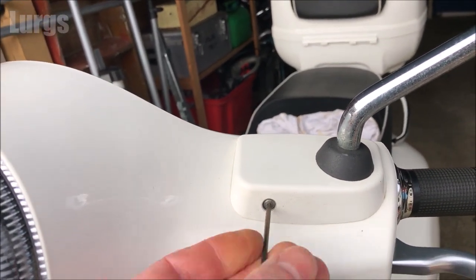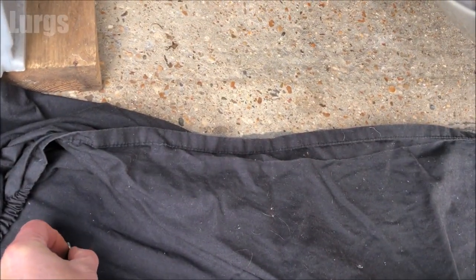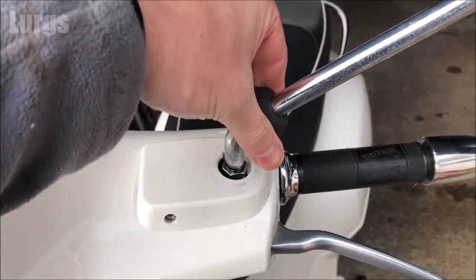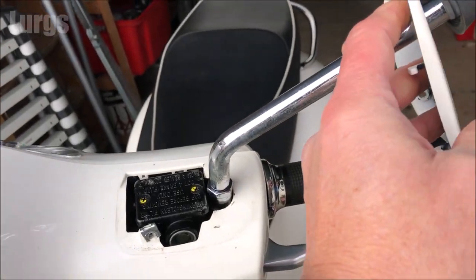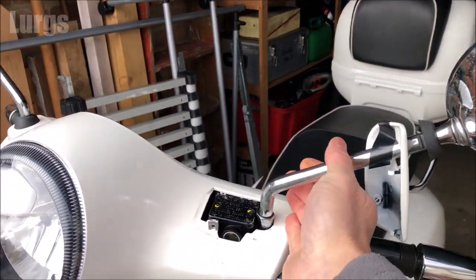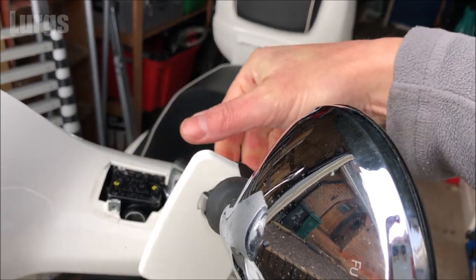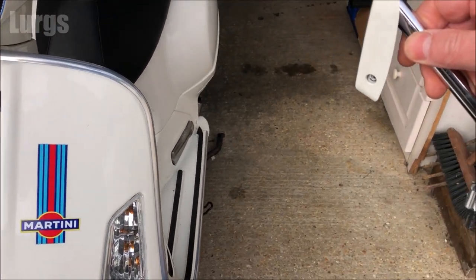The next thing we need to do is remove these on both sides. This is a very small allen key, so just take a small allen key and again you're turning this anti-clockwise. Put that somewhere safe, take this rubber catch and just slide it all the way up the wing mirror, then take this fairing — just be very gentle with it, it's got some clips at the back, don't be too aggressive, you don't want to snap any of the clips. Over time these get brittle. I'm just going to tape it to the top of the wing mirror. Now on this you're basically turning it anti-clockwise, just need a bit of elbow grease — there we go.